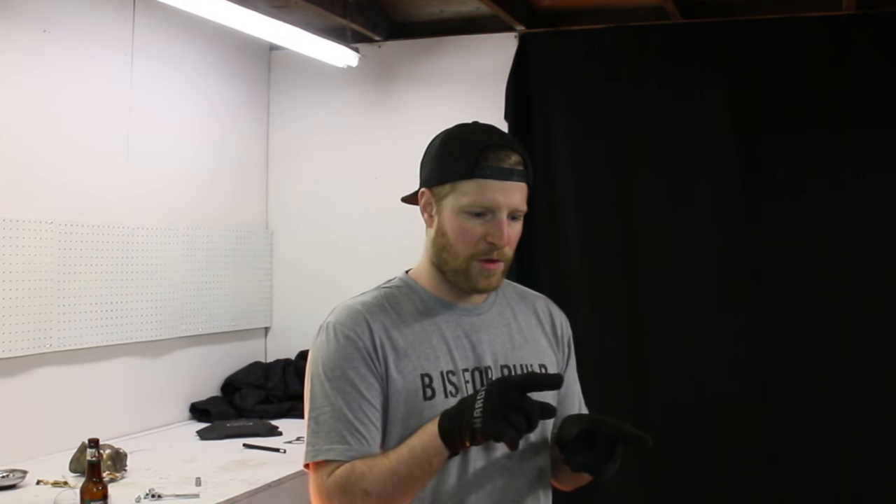We got our Zeta exhaust system fully bolted on. We got the back on without really any problem at all - bolted it all up and bolted our carbon fiber tips on the end. A couple of review notes: the flange that goes from the Nameless Performance front pipe into the Zeta exhaust needs much smaller bolts than what the Zeta exhaust needs, so make sure you have the right size bolts for your Nameless exhaust parts. Also, exhaust hangers can be a pain - those little rubber bushings that hook your hanger to the hanger can be really hard. Just remember to wiggle them back and forth and do almost a screwing motion; it'll help the hangers slide through more easily. Other than that, this thing went together really great. I've got a few more bolts to tighten up on the exhaust manifold and then we're ready to kick it on and listen to it run.